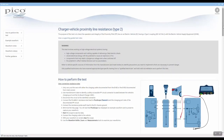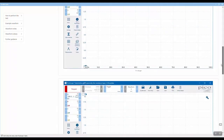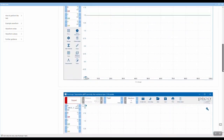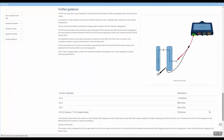Here's the description on how to perform this test — remember it uses the resistance lead. The cable under test is a Mode 3 but it's disconnected from the Mode 3 charger, so we're testing just the lead, not connected to the mains. That value gives us the resistance of the resistor inside the Type 2 connector, and from that we can work out the current capability.